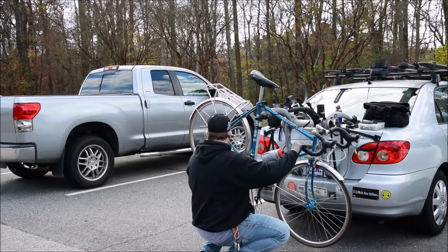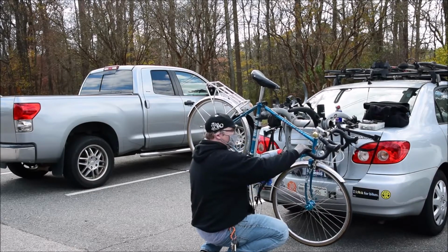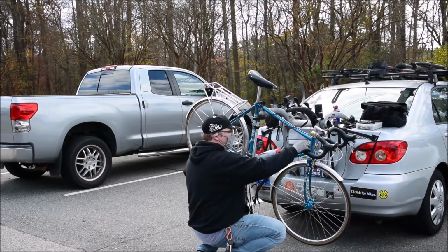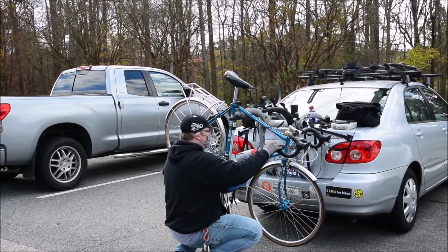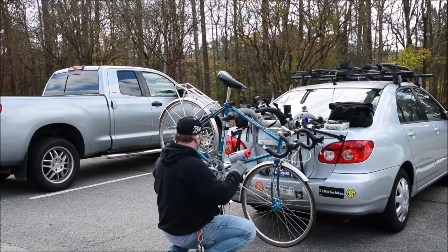The key thing to tuning any gears, you want to go one click at a time whenever you're checking to see how it moves up on the set. So you don't want to just go up and down and up and down. You want to go one click at a time to feel out where there's any kind of an issue.